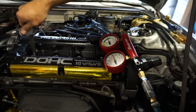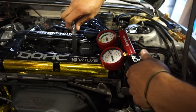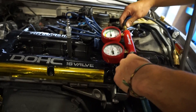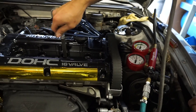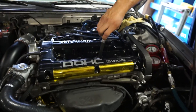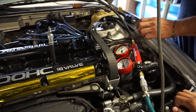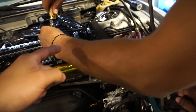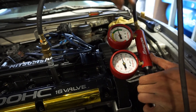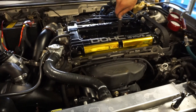As long as it's in the green you're good. You only have a problem once you start getting close to the red — more than around 25% would be a concern. This is the last cylinder. What you're doing is compressing the cylinder and seeing how much air it retains. We're reading about three percent. Healthy! All four cylinders are good — nice.